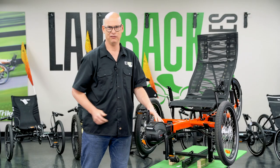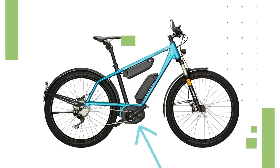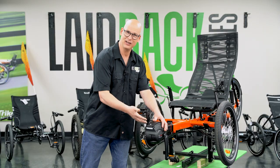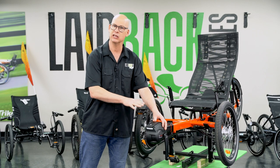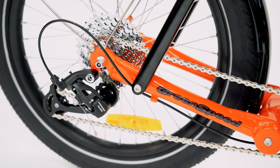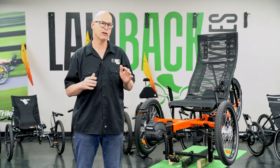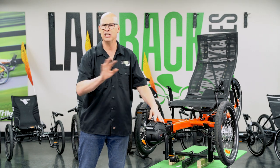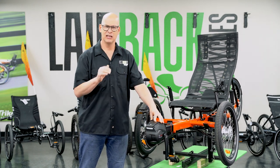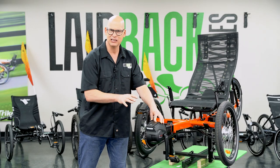It is considered a mid-drive. Mid-drives are in the front of your trike, but they're mid on a bicycle, so don't worry about the name. In the trike world, we should just call it a front drive because it's in the front of your trike. This does use the gearing of your rear hub, so you want to make sure you have either a 9, 10, or 11 speed chain with cassette for a full gear range. The triple or double chain ring you used to have is gone — the motor compensates for that.